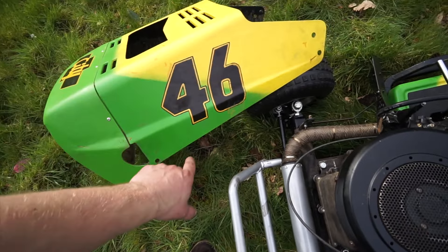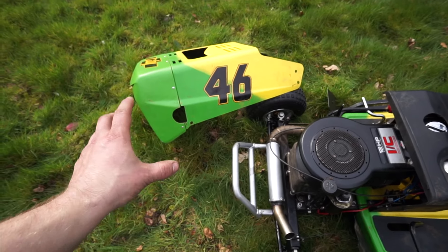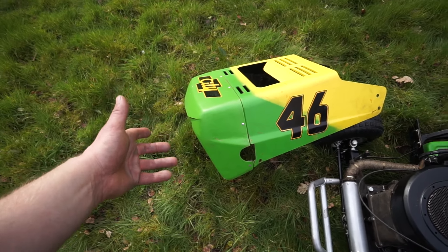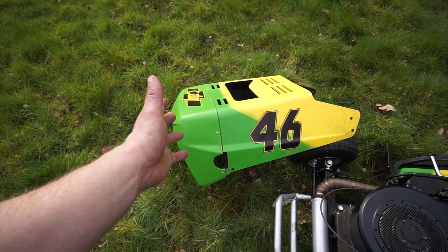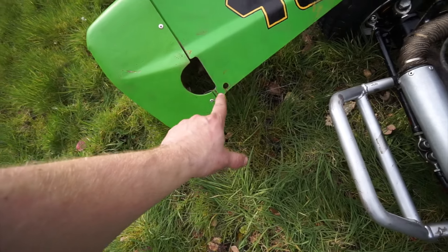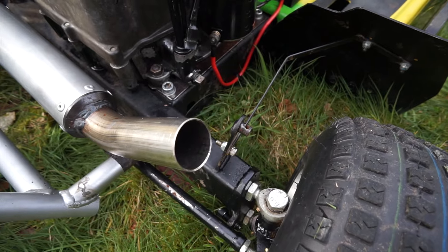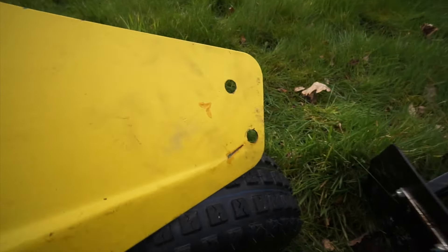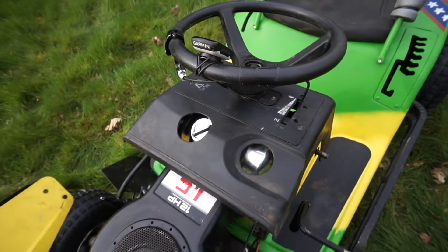One thing about the bonnet — you can see the holes here and there. With the stock wide-body bonnet, the front mount point for the bonnet is on the plastic nose cone, and that was one of the problems that actually started the breaking process — it made the whole thing disintegrate. So now we've got that light front nose cone riveted onto the metal piece at the back, and the metal piece is what connects onto the tractor. For this front point here we now have these little spuds — little grow-outs there — and one at the back as well, and that's the original hole. We put one down there just to give it a little bonnet lift so we have a bit of a vent at the back to let heat escape when things stop.